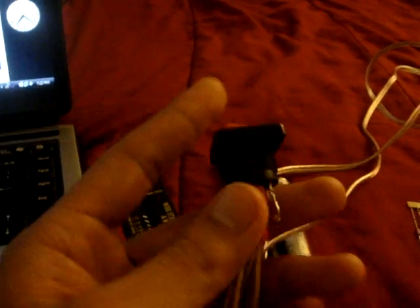Now, testing your TRE — how do you know if it's working? After the bike is warm, flick the switch on and off. When the TRE is on, the RPMs will drop around 300 to 500 RPM. That's why you want to install the switch, so on cold days you can start it and this thing won't give you a problem. When it's warm, just pull in the clutch and the RPM should go up at least by 700 to 1,000. That's pretty much the only side effect — the RPM goes up when you pull in the clutch, and when starting up it can give it a hard time in cold weather. But this is the homemade TRE switch. That's all I got for you guys. Drifter out.